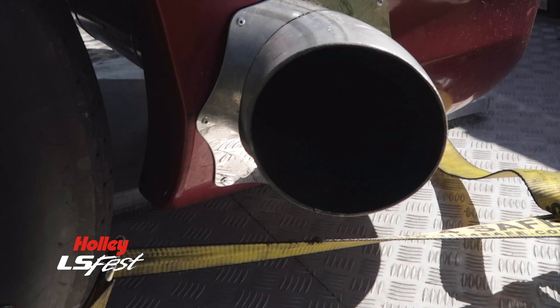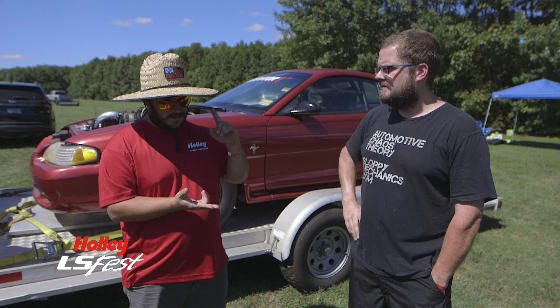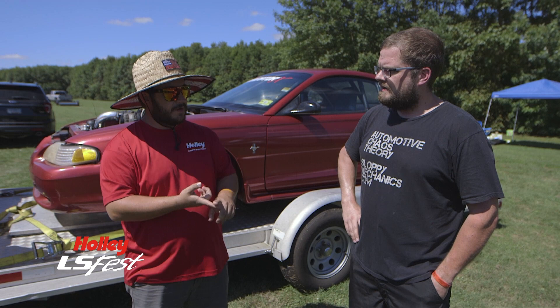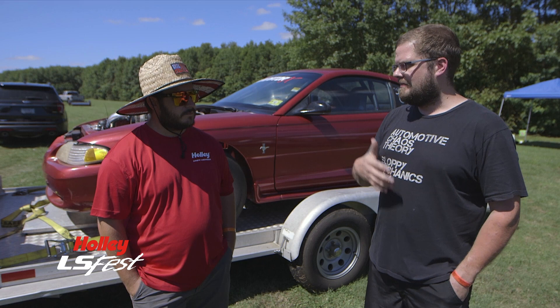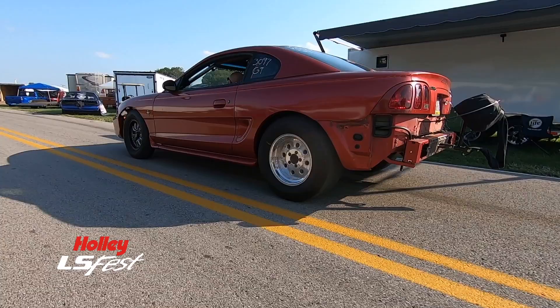You've spent a lot of time tuning on Holley EFI stuff, factory ECUs, and some other standalone setups. What's nice about the Holley products is the software is almost 100% the same across units, and the ECUs act almost 100% the same — so once you learn one of them, it's extremely easy. On top of that, the complexity isn't there. You don't have to fool an emissions device or figure out what the ECU is doing behind the scenes. You just tell it what you want it to do and it does it. The majority of the functions have closed loop, so you can tell it what you want and it helps you attain that target. It's not working against you — it's helping you the whole time.